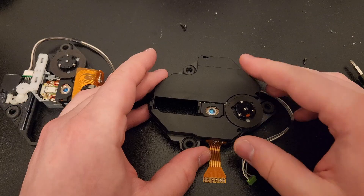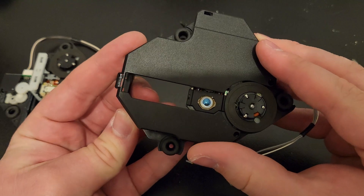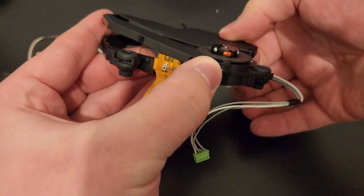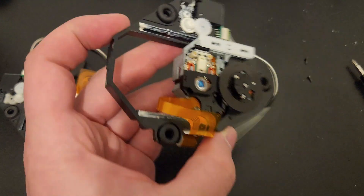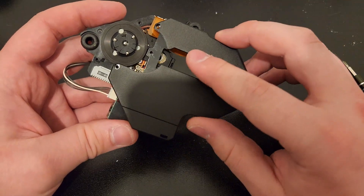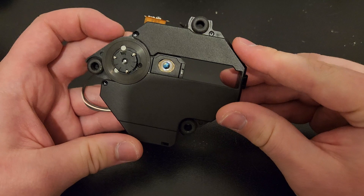Now that the new disk drive has the plastic piece taken off, we need to take off the black plastic piece from the bad drive and transplant it onto the good drive. Same as before — two screws. You've got to pop off this tab right here. Now push it over and kind of tip it up. Be mindful, there is a clip here as well. You don't want to bend this part upward — just slide it out. You can toss the old drive now, it's no good at all. Now we have the donor drive with no plastic and the original black plastic — just put them back together. I'm pushing down right here to flex it a little bit, which allows it to slide in pretty easily.